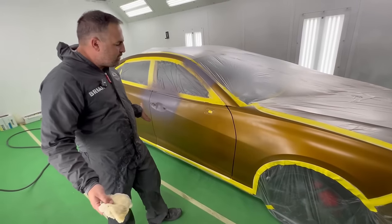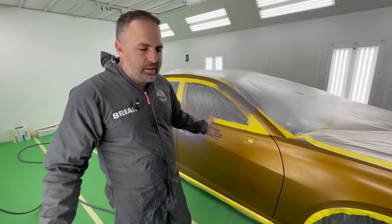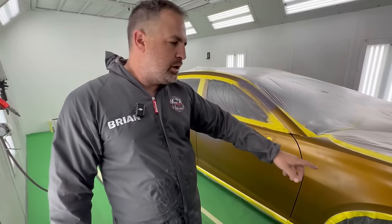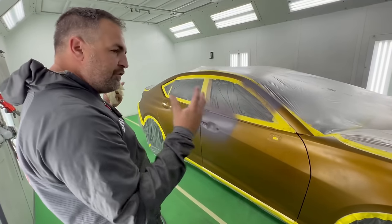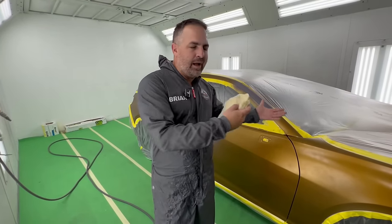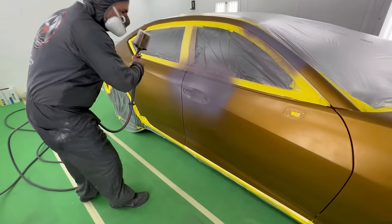That way, let's say we didn't do that fender. Why not? All it is scuffing it up, right? So now we would be forced to blend it in here and we're one panel short of painting the whole side of the car and visually looking at this car from the side and it all looks like one color. Don't take the risk, guys. Just think about how much better that's gonna help you out in the booth. It really is.